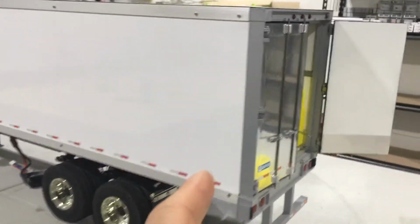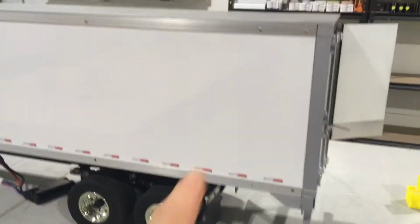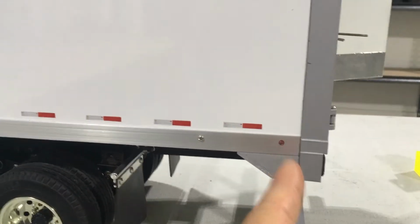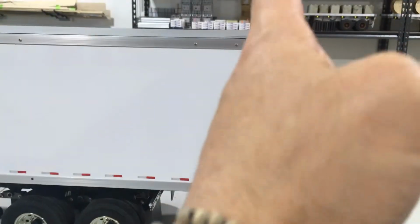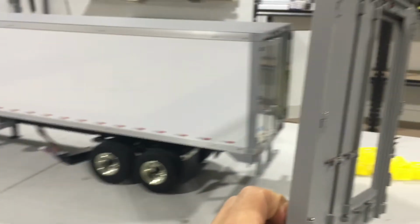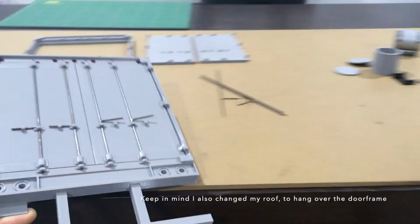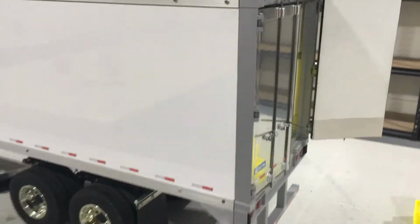But like I was saying, the fabrication isn't, you know, it's not easy. I did have to zip off the entire back end, including this little aluminum channel here at the body, this bottom aluminum channel, and a bit of the frame there you see on the bottom, so that it's all nice and flush. And then I just 2-part epoxied the entire unit right to the back there. And I don't really have much of that footage of me installing this in that build series of these trailers, but just to share with you guys how I did it.